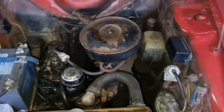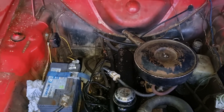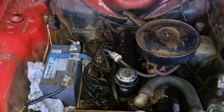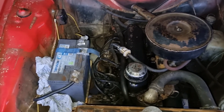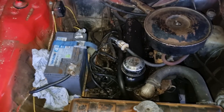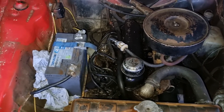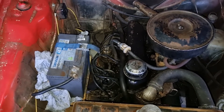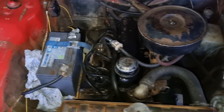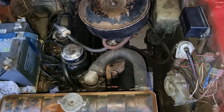I've measured it on the battery - we have 12.456, maybe 12.7 volts depending on how much stuff is on. 12.7 is absolute max with everything turned off and only the engine running, and it charges at 12.7 - which is nothing. That's the lowest of what a good battery is supposed to be at on rest. So I have been working on fixing that problem.